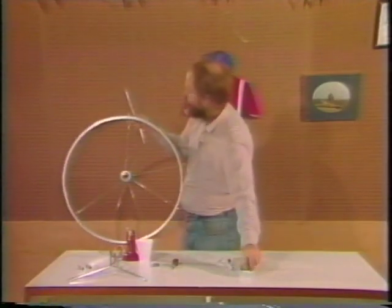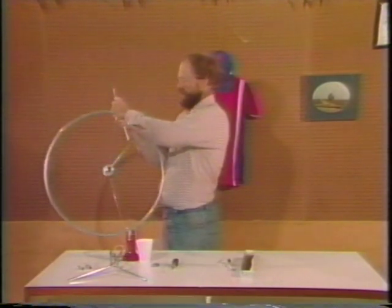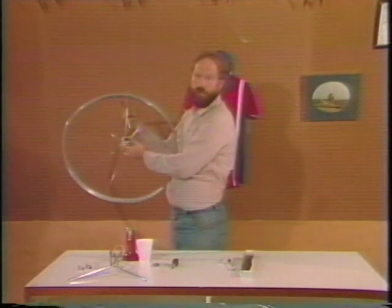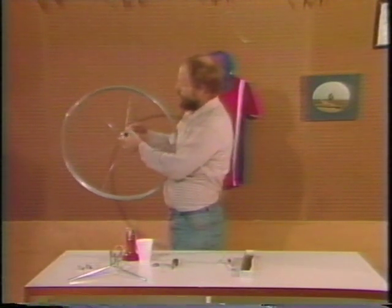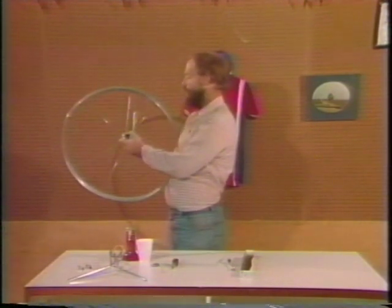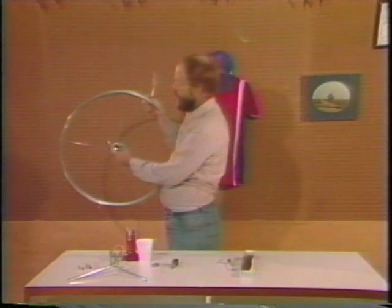Now this is tricky. You want to really pay attention here. Make sure that this spoke is going to the same side of the valve hole that your original key spoke goes to. Make sure that it's coming from a hole on the hub that would fall just barely counterclockwise of the hole on the hub from which your original spoke emanates. And then it should look like that.